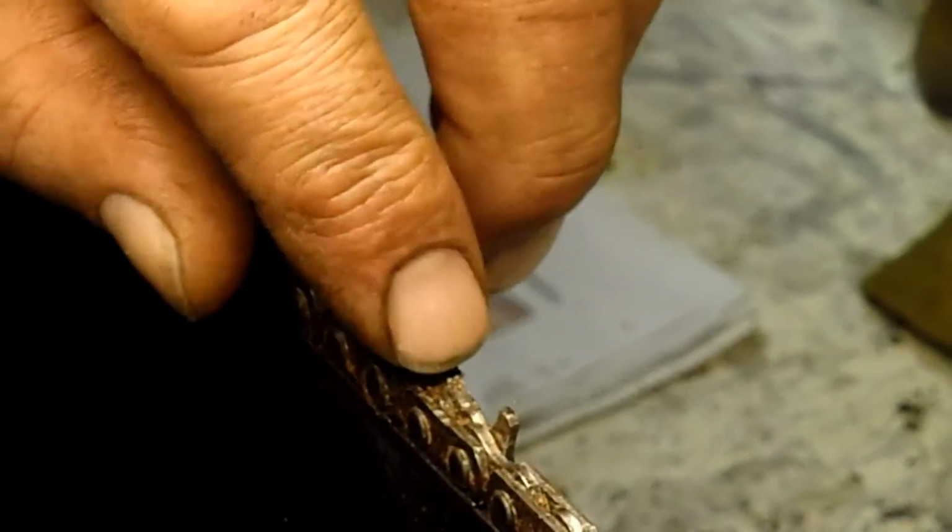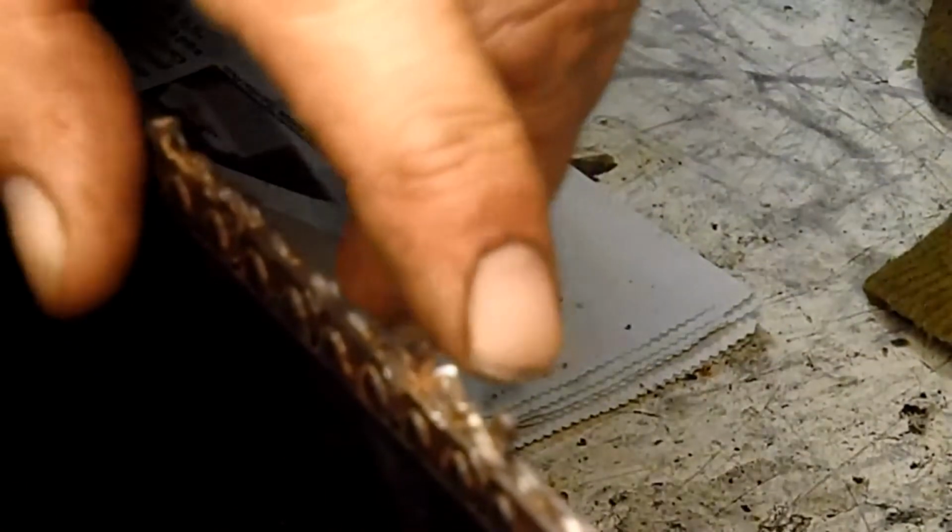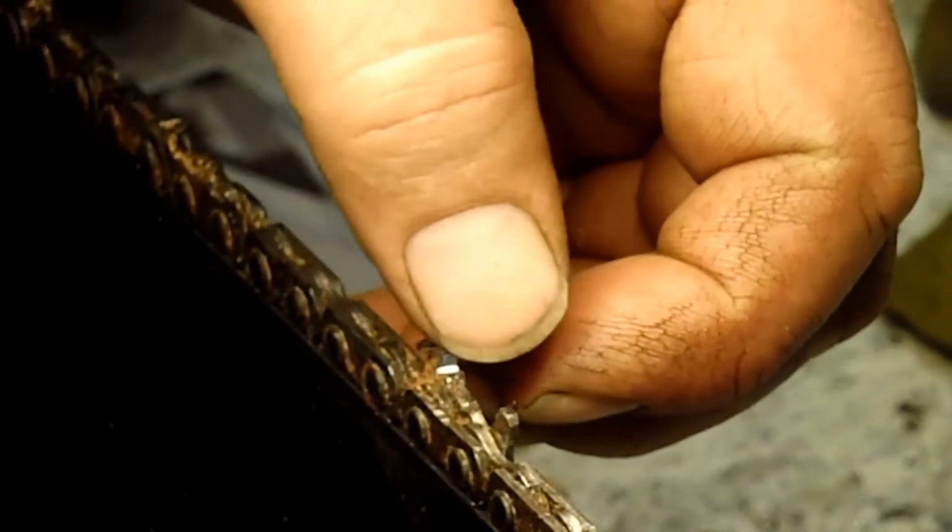But with a good sharpened chain, you don't have to try to, if you're putting the dogs in and pulling up on the handle, if you're breaking engine mounts, shock mounts and things like that, breaking the stuff on the bar, the bar fittings, the problem is you're not sharpening your chain, you're pushing on it too hard to get it in. It should feed by itself. When it quits feeding by itself, it's time to quit and sharpen it.